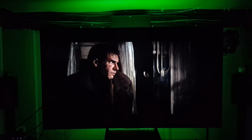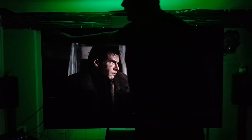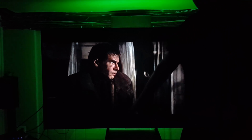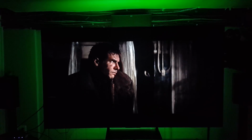Now, for flashlighting and clouding, what we're really looking for is not really in the image here. It's typically on the corners. Flashlighting tends to come from, or especially edge lit bleed, for those of you that have a 930E, you will see it right in the corners, and it will permeate the black bars. It'll look like a drip. Now, when you get into flashlighting with a full array, you really shouldn't see it.